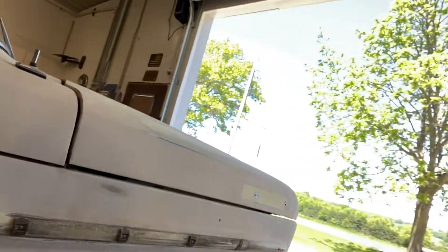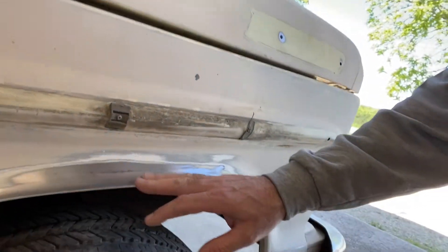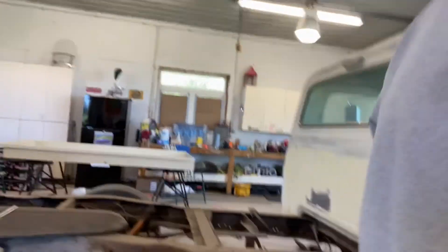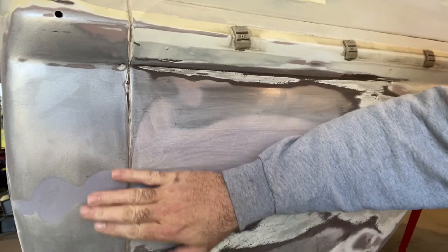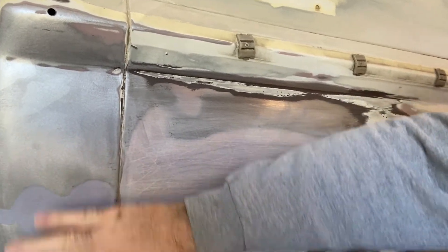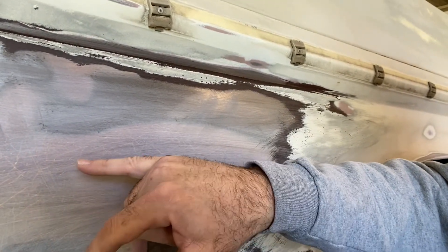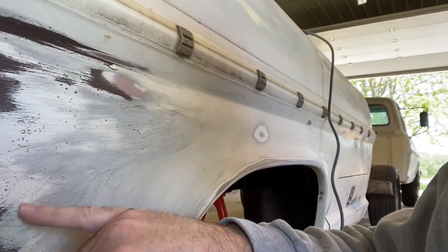I'm not going to tape most of that because it's just tedious sanding, so I'll give you a little update. There's a little bit of surface rust right here — cut it down and treat that. There's one place on the box here, I don't know if it was bad. Must have been a little filler spot. Right in here is a little spot. I took that down to bare metal and I have to put just a little bit of filler in there. You can see there's a little bit of filler here that's cracked and that came through into the paint.